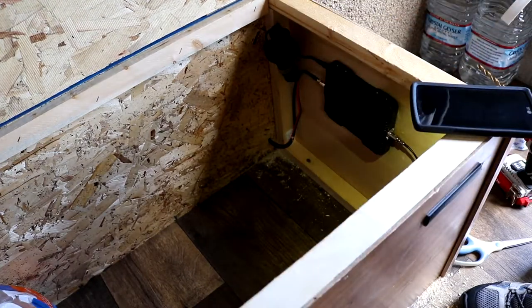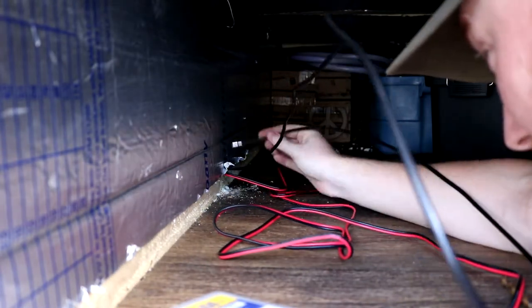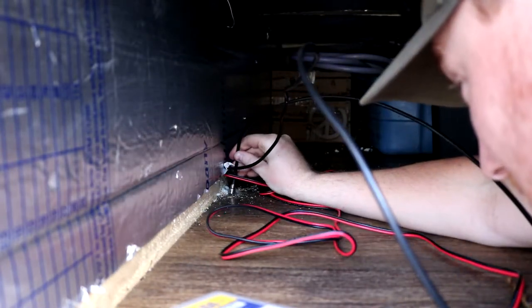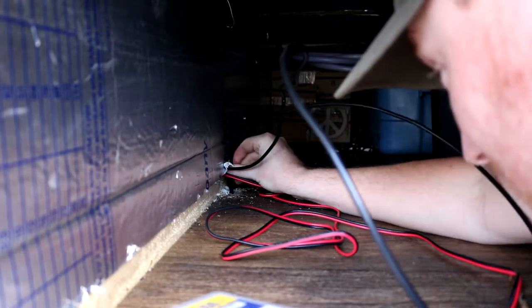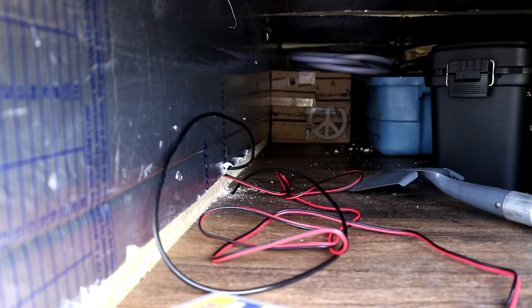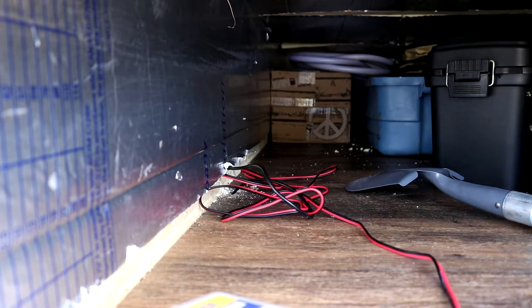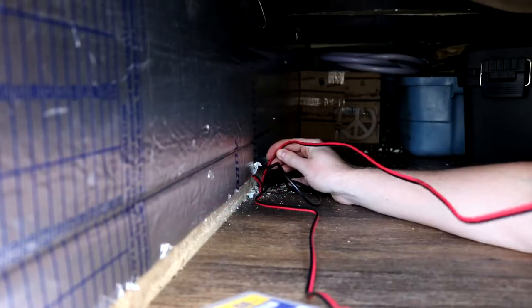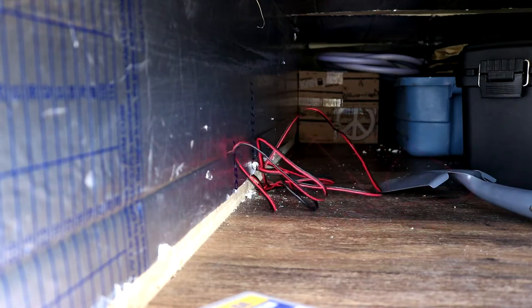And that pretty much wraps everything up for the inside here. So next I'm going to go ahead and pass the antenna cable down through a hole that I pre-drilled in the floor to go underneath the trailer. And then I'm going to pull it from underneath just to get it close to where it needs to be. And then do the same thing with the DC cabling. Feed it through, pull it, and then I had to reset it and re-untangle it slightly a few times just to get things to work out well.